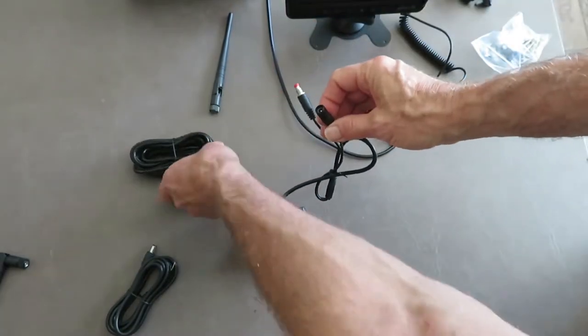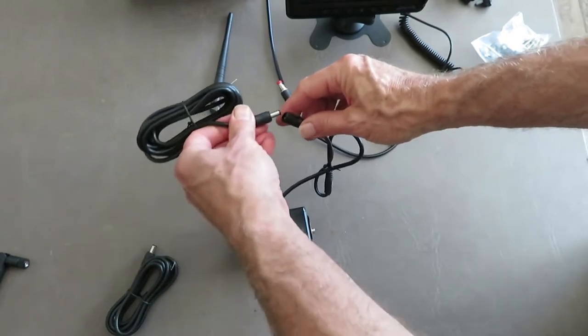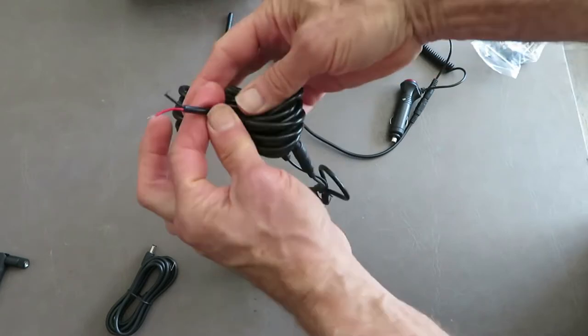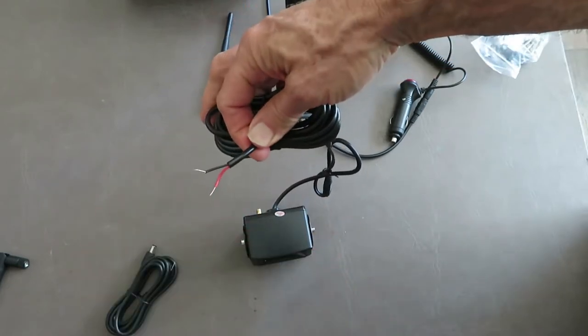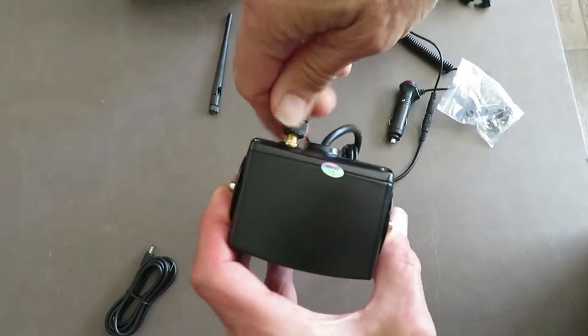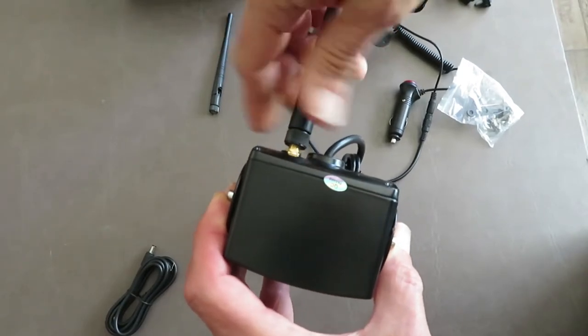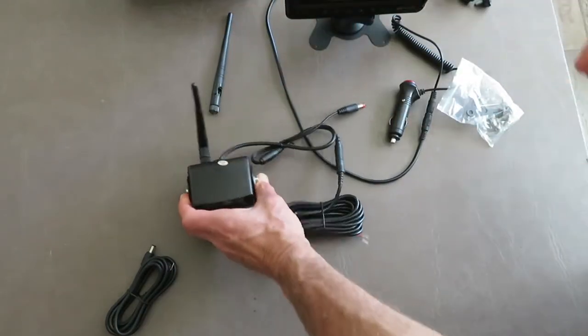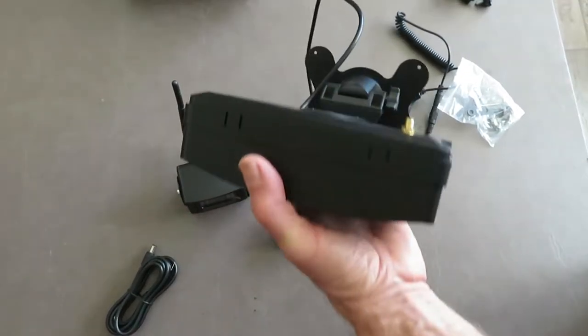There's only one cable for the camera unit — it would be the longer of the two DC power cables. The red end is going to go to either the backup light or the running light, and the black to ground. Now we're going to attach the antennas to both units — they simply screw on to the jacks and are identical and interchangeable, whether for the monitor or the camera.